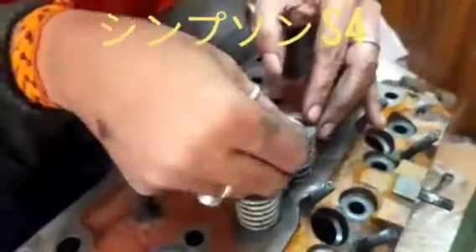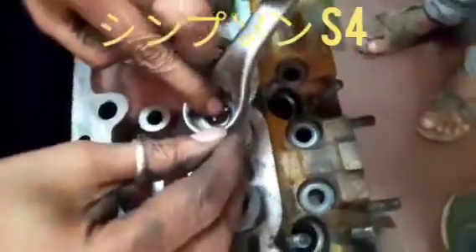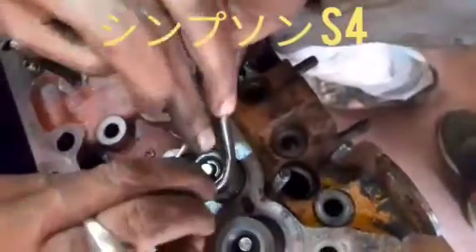Then we can fix the collet, and this work will be held on the side so we can fit the collet of the cylinder head valve like this one. Because this spring tension is very less, we can fit the same without any tool. So this is the process for fitting the cylinder head valve collet or valve lock into the cylinder.